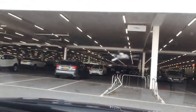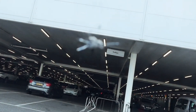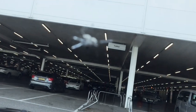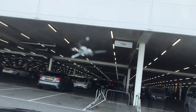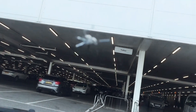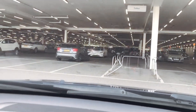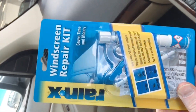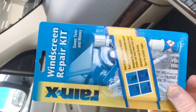Back to the windscreen repair. I've got this rather large stone chip here in the glass. It's not yet cracked but it will do soon — some cold weather or going over a bump too hard will probably crack it. It's not an MOT failure where it is because it's not in direct view of the driver, but it'll definitely crack sooner or later and then it would be an MOT failure, and a new screen would be quite expensive. This one's got a heated screen so it's probably three or four hundred quid. Even on insurance the excess is probably ninety or a hundred quid anyway. So I bought this very cheap windscreen repair kit — it's £15 in the car spare shop, you can get them for about eight or nine quid online.